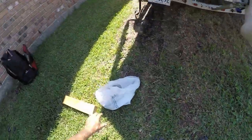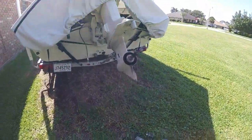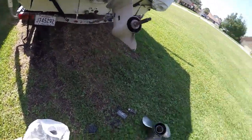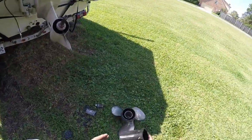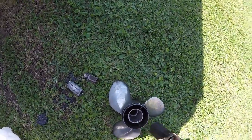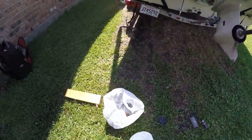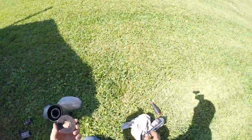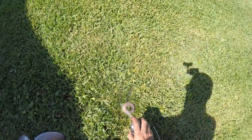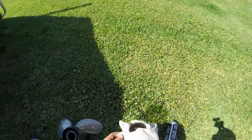The new one we got is a plastic one. What this thing does is — if your prop gets stuck, spins out, or stops — you don't want to mess up your gears, so it'll blow this piece out instead. That's a great design. It fits in perfect. I'm going to clean this washer up too. It might not make a huge difference, but it's important that you have the right size washer.